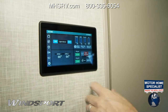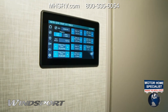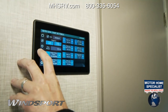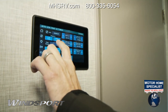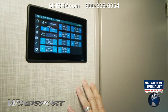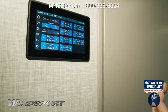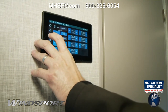House battery is at 13.6 volts, chassis battery at 13.7 volts. You can turn on auto gen start — set a trigger for low volts or HVAC load. For example, if you have pets inside and the thermostat calls for cooling, the generator will kick on automatically when not on shore power. You can also set quiet time, start voltage, and retry attempts. We have an in-depth video on our YouTube channel covering how this whole system works — post a comment and I'll send you the link.